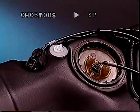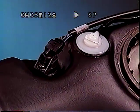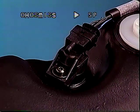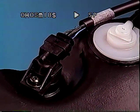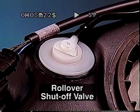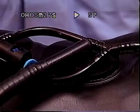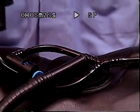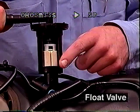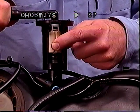For OR-VR, the fuel tank pressure sensor is moved to a mounting on the tank instead of the filler neck. The rollover shutoff valve now has a port to vent the air pressure created in the tank during a fill-up; this air passes through the valve and is carried to the canister. The float valve also connects to the canister. When the tank is almost full, the spring-loaded float closes and liquid fuel is prevented from entering the canister.